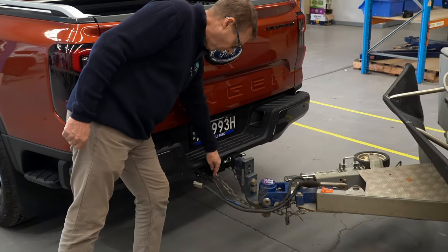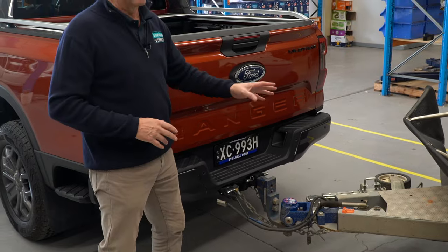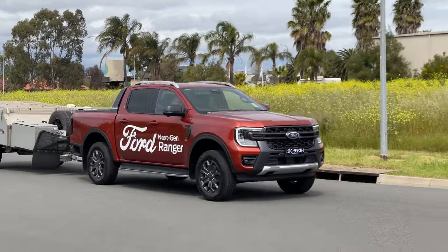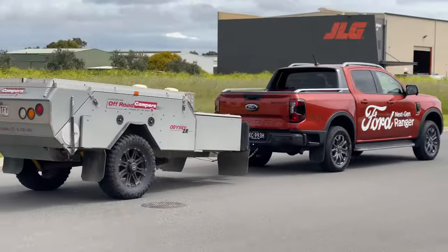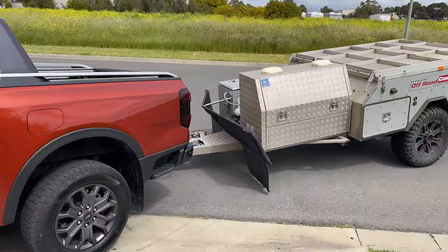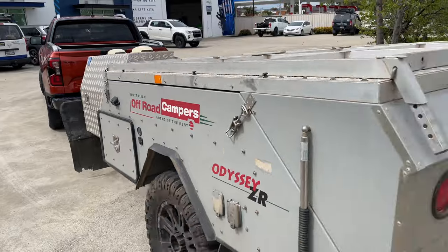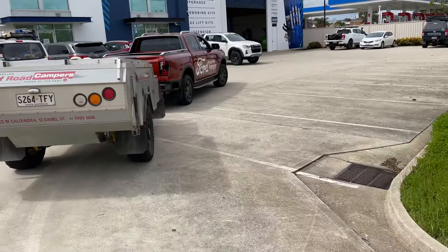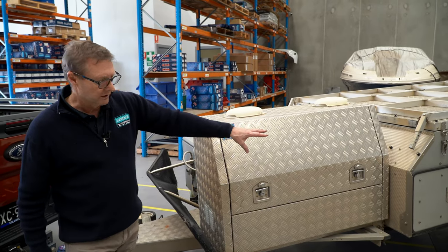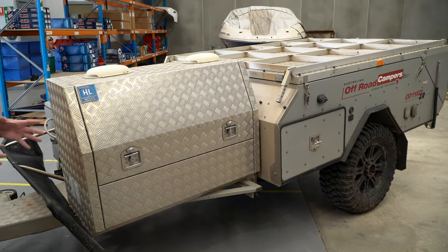In this case the car has been wired with a 12-pin plug — your standard 7 plus the extra 5 for caravan power, triggering a fridge, or the brake safe function required in New South Wales for towed trailers. The controller is suitable for trailers with electric and electro-hydraulic braking systems with disc or drums. This particular camper trailer is under two tonnes and came from the factory with electric drum brakes. Bigger vehicles over two tonnes typically have disc brakes, and this controller can handle all of those.